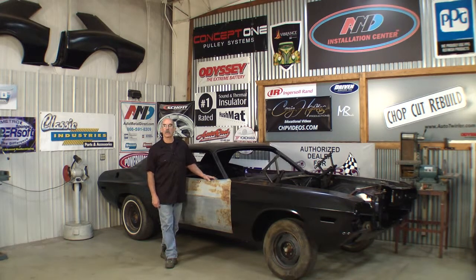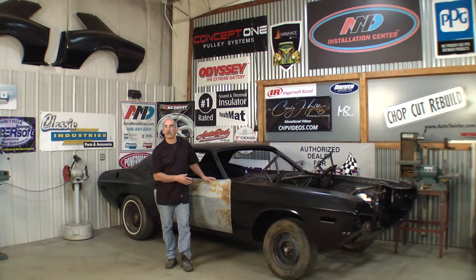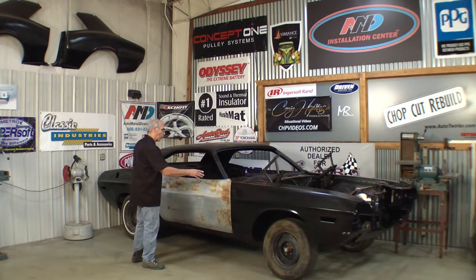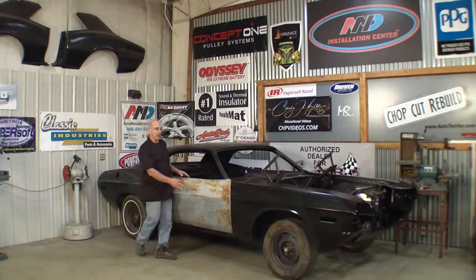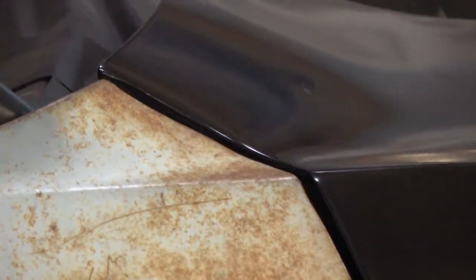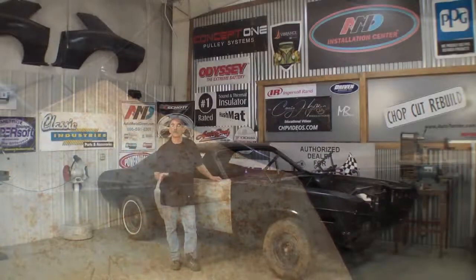I'm Craig Hopkins and I want to share tips with you on successfully skinning a door in your home shop, backyard, wherever you really feel like you want to skin that door. Let's discuss a few things and then get into skinning the door. One key to successfully skin the door is that it has to fit the car — it has to gap and profile at the back and at the fender. If it doesn't do that, you cannot successfully skin the door.